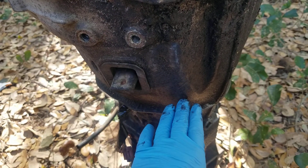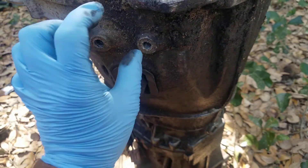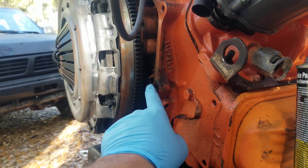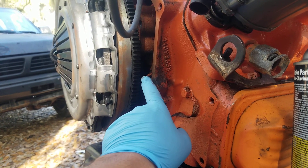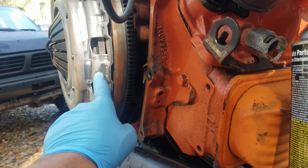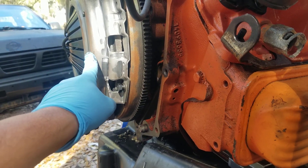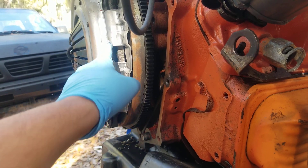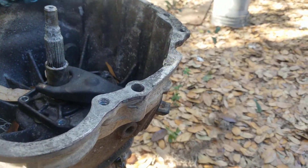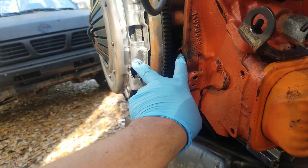From here down to the cut that we would make, everything would be the same diameter. But from here up — from the base of the engine to probably right here, not the edge of the pressure plate but right here — because all this is the widest area that would never get past, it would hit the outer rim of this transmission. But that distance is something like two and a half to three inches.